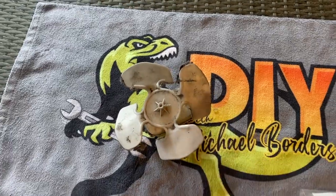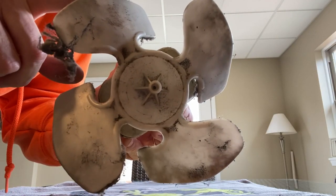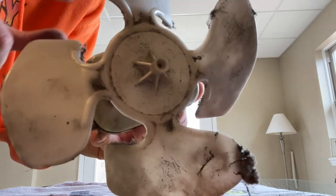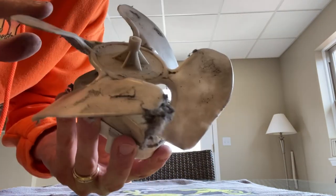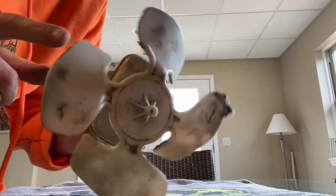When these wear out, the inner bearings begin to fail and they make an obnoxiously unpleasant sound. I want to show you it — I've got the motor and fan in place, and just by spinning it you'll hear how obnoxious it sounds. You can hear it winding up just by spinning it with my finger, which does not spin it at the rate that the motor does when it's turned on inside your refrigerator.